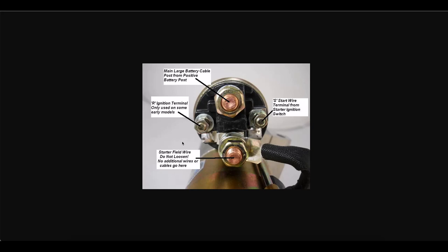Here's a close-up of all the wiring that goes to these. You've got your main battery, which is always hot, and then a couple of small wires coming in depending on the application — not a lot of room in there at all. There are three causes. One is just simple heat — sometimes the heat dissipates enough, but not typically. Another solution is to put in a high-torque mini starter: it's smaller, further away from the exhaust components, and typically better quality.